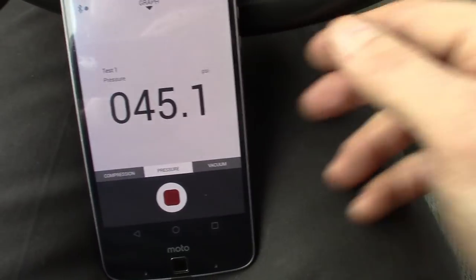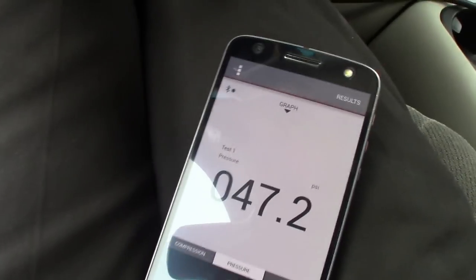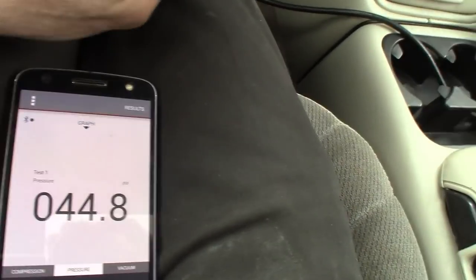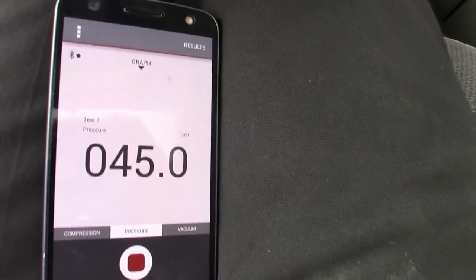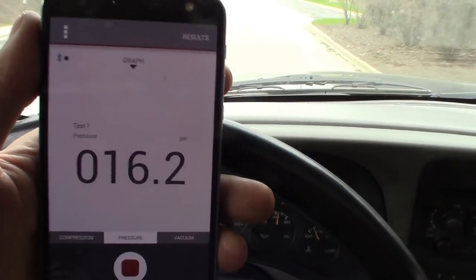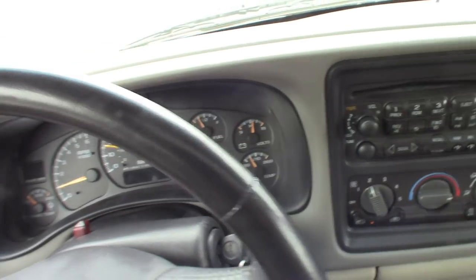Alright guys, let's see if we can do this without causing an accident here. We got our fuel pressure there — start off kind of slow. We're at 49. Take it to my little spot where I like to test drive, and then we're going to gun it — we'll actually be able to see the issue here. We're at 44, going to gun it. And it's starting to fall on its face. We're almost down to 10 PSI, 12. Not going anywhere — I had that thing floored. You just lose all sorts of fuel pressure.